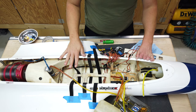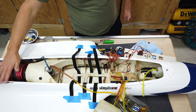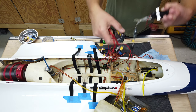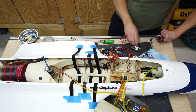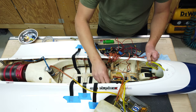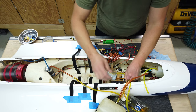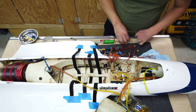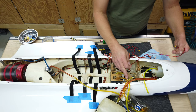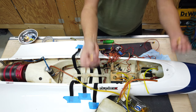Let's do some quick mock-up and see how things are going to work. We'll just lay the engine in there — we have to do some modifications on the rails, which I'll show you. Here are our three items to figure out where they're going to go. I'll lay them where I think they'd fit well. We have the fuel pump here and the ECU here. The first thing I want to check is cable length. The cable from the ECU or data relay module to the turbine — we've got lots of distance there, so not worried about that.